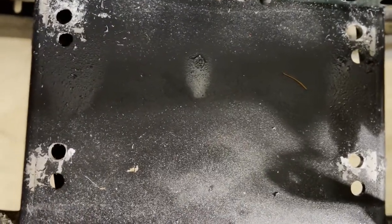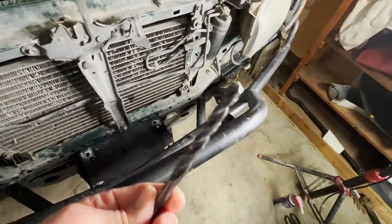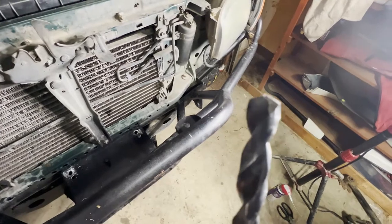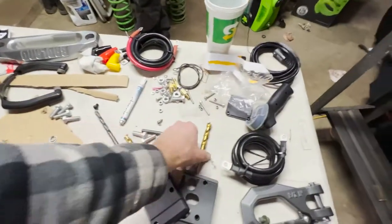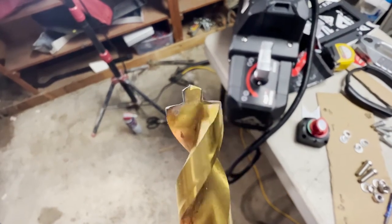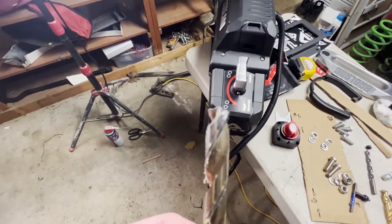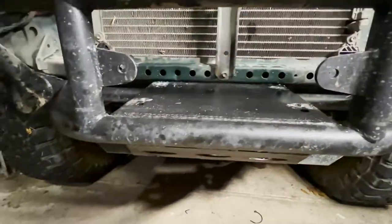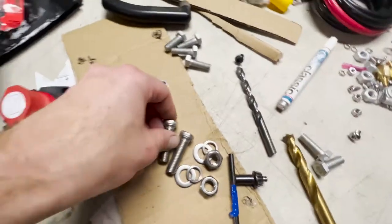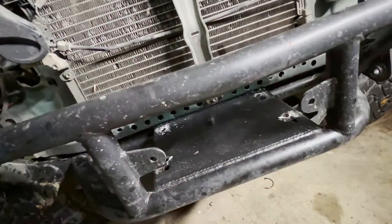We've got all our holes drilled — we ended up using a half-inch bit. This is the type of drill bit you need for drilling through steel, which is about quarter-inch mild steel. It has a pronounced bevel to it, whereas the other bit — which has a center pilot starter and a flat profile — just was not doing the trick. This is just black oxide steel, not titanium, but it worked out well. The winch fits. Now we also need to drill out the Hawse fairlead holes since the studs that come with the winch are half-inch and the fairlead holes are three-eighths inch.